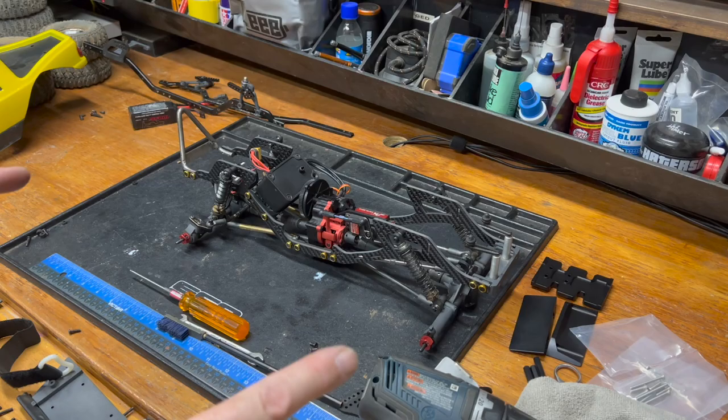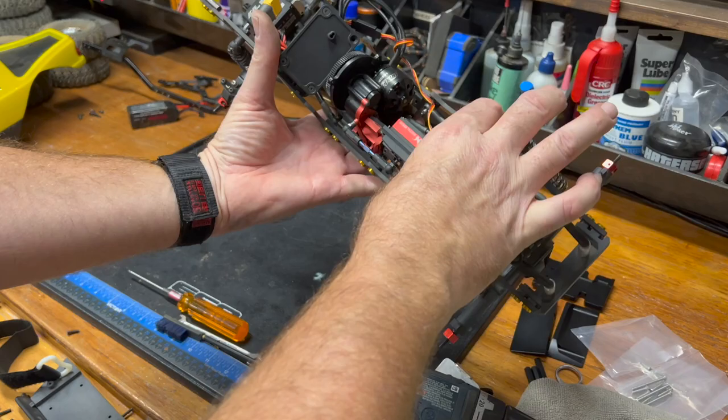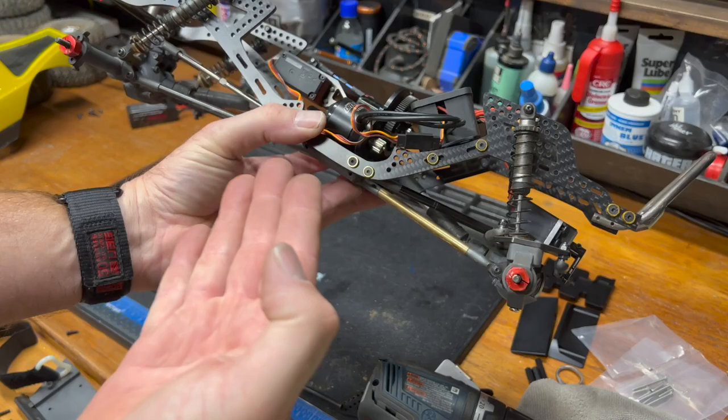At this point in the assembly, I have no issues that were not self-generated. In an effort to conserve energy, I basically just moved the whole rig over. And you can do that. All the holes absolutely line up. No problem there whatsoever. We've got that tiny little bit of pinch, typical of how a flat plate chassis works. I am going to have to install braces. The front is pretty stiff now that it's got here, but with nothing back here, we got a lot of flex. Stuff I had neglected to recollect in my brain.